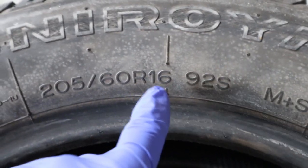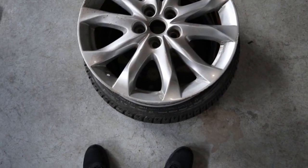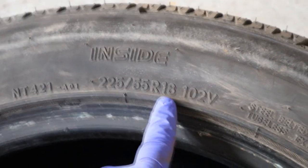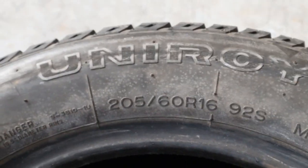After all that, you have the number 16. This 16 represents the diameter of the rim — it tells you what diameter rim this tire is suitable for. The rim that goes inside here should be 16 inches. This here is an 18-inch rim — clearly too big, do not use it. But on this other tire the rim diameter is 18, so now I can use this rim and fit it to that tire. Use the right rim size for your tires.